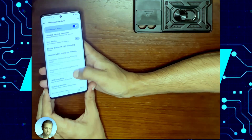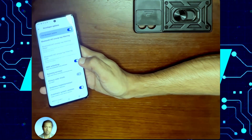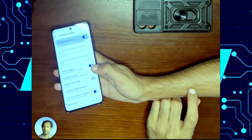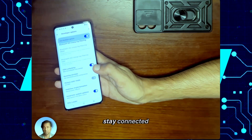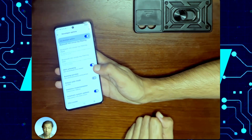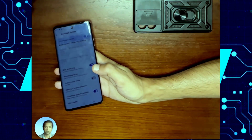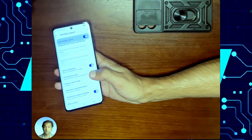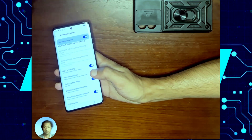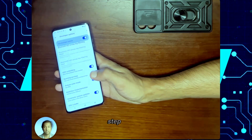Go into Developer Options and you'll see whether you have an option for OEM Unlocking. Make sure you turn that on and that will let you unlock your bootloader. Now this option might be grayed out, in which case you might need to stay connected to the internet for seven days before it becomes available. Just because this option is available doesn't mean you can actually unlock your bootloader and root your phone — certain carriers don't allow you to unlock your phone at all. So for example, if you have a Verizon phone, you're out of luck. But if you want to learn more, I have another video linked in the description below.